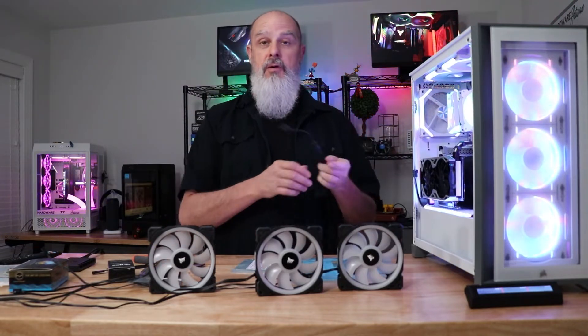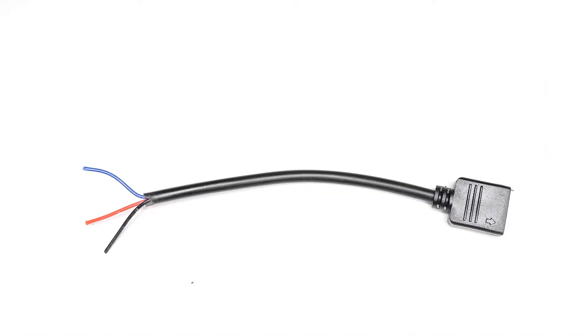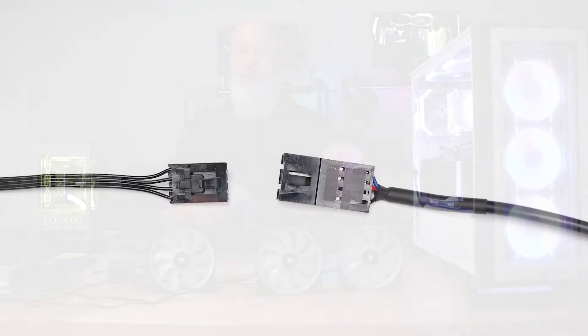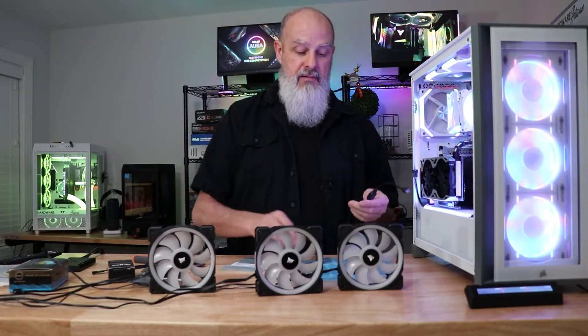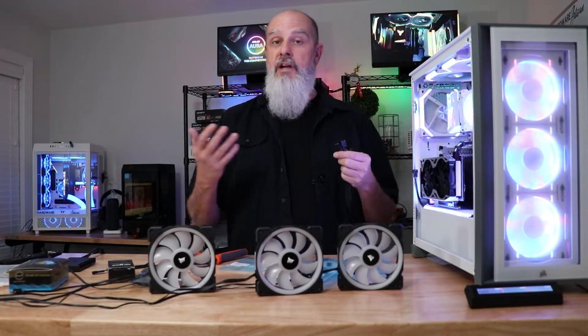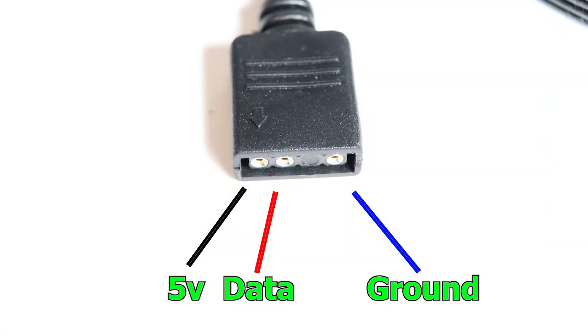In my case, I'm simply going to take a pre-wired 3-pin ARGB connector and put the receiving end of this connector on there. To build a basic adapter cable, you just need the connection pin and the housing to receive it. You want to pay very special attention to the pinouts — you could damage equipment if you get some of these reversed, so if you're not sure exactly what you're doing, stop and study the information for a little bit.